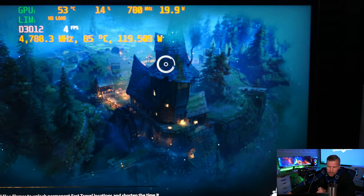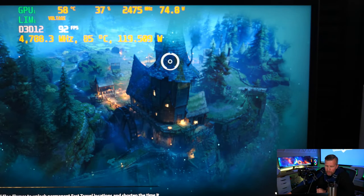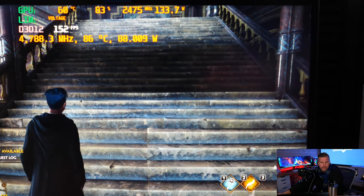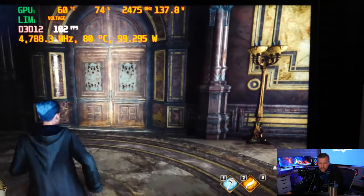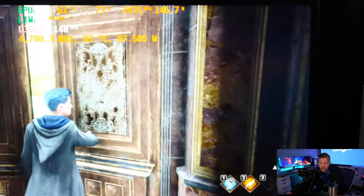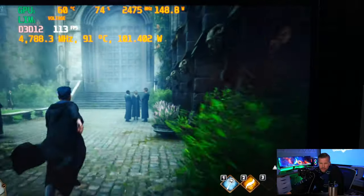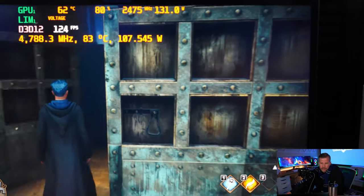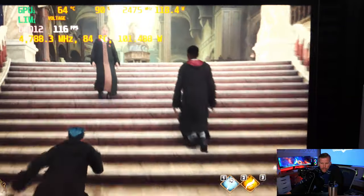It's interesting, Jared. This laptop scored higher in the 10-minute Cinebench R23 test with the i9-13900HX than the G18 did, which is surprising. And it was mainly because we could raise the power limit manually in Intel XTU above 140 watts, but still.